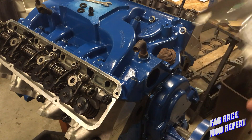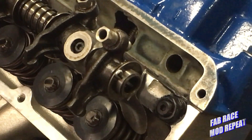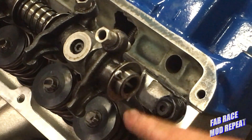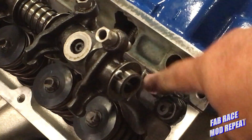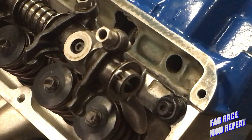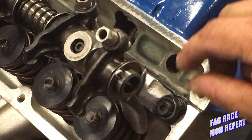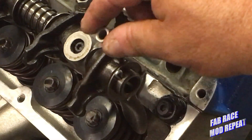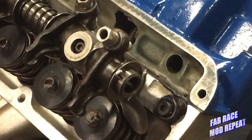That's really all there is to measuring pushrods. Now you need to make sure if you've got any extra accessories — like this one has an oil splash shield. We're actually going to put those back; we've got to modify them a little to clear these rockers, but there's your oil splash shield. You want to make sure you've got that in place, because it sits under your pedestals and adds a little bit of height — the thickness of that metal, about 18 gauge steel. So your pushrod is going to need to be a little longer, and you can take out the play and get your exact position with these adjustable nuts.